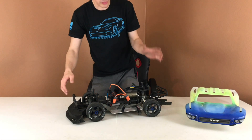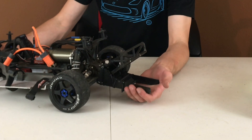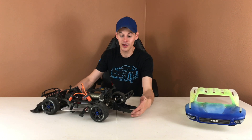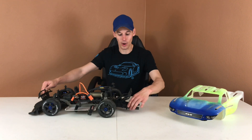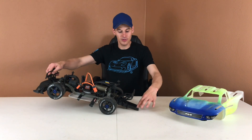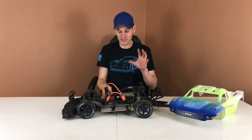In today's video the thing I'm going to do has really nothing to do with aerodynamics — it has to do with grip. The wheelie bar broke off. This wheelie bar was made for a two-wheel drive Traxxas Slash like a dragster; it extended all the way out but it broke a video or two ago. When I got up to 97 or 98 miles per hour I wasn't even running with it, but with the body on the rear end got a little squirrely — I think air was getting underneath and taking weight off the rear end. So I zip-tied what's left of the wheelie bar back on, just so if this thing does lift up it'll scrape against the ground and keep it from flipping over.